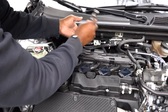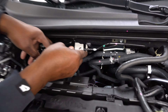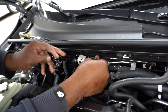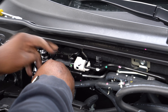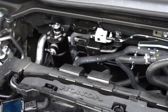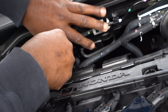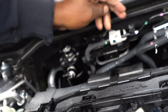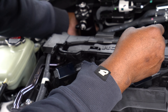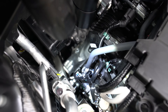He's going to tighten up the 10mm bolt. Now we're going to put everything in where it's supposed to go — and then clip those two pieces in. That's in. Now we have to take the stock hose off for the intake manifold that goes to the valve cover. We're basically taking off this hose right here — there's a clamp right down there. That one goes into the intake manifold over there.